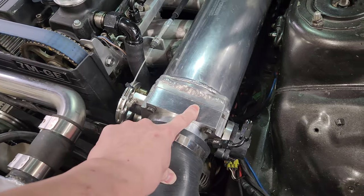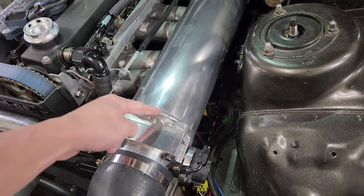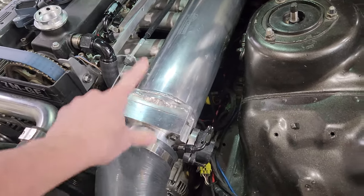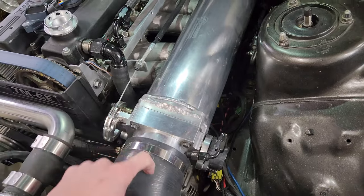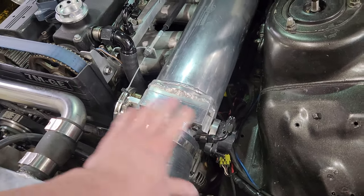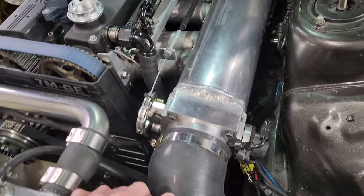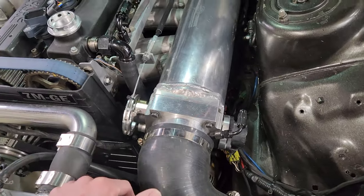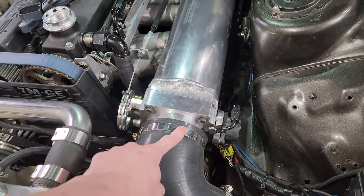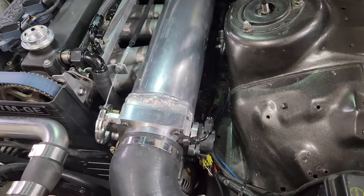It's ideal to weld the cable tension on, but I just utilized the bolt coming off the head, made my own little bracket, bent it around, notched it, dropped it in with two nuts and tensioned it until I had good tension. It's perfect — been running like that with no issues. I've had to adjust it a few times as things warmed up, but it hooks right into the blade on the throttle body with no problems. Now for the throttle body — this is a 90mm throttle body. I've got two welds here. If you buy this plenum it already has the four-bolt flange on it and they claim it's for a 90mm throttle body, but it didn't quite work with this billet one I got. This is eBay — so is the plenum. Quality on the throttle body is not the greatest, obviously you get what you pay for — it was about $100. I pulled the two screws out for the plate and blue Loctited them so I don't have to worry about them getting sucked into the intake manifold.